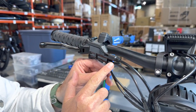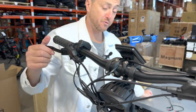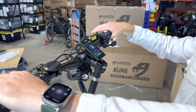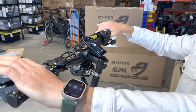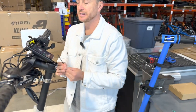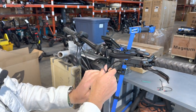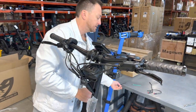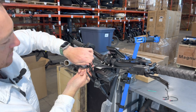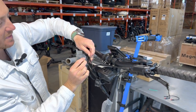The problem with the faulty sensors was they were very sensitive, so they would go off very frequently, getting stuck all the time. But with these replacement sensors, they're not as sensitive — you can go a lot deeper and they will be working for you just fine. So that's that. Finally, you can add a couple more zip ties if you like just to organize your cables a little nicer. Let's do that quickly just to make a nice clean job — I'm going to take these wires together. And if you have shrink tube you can re-shrink your connectors.